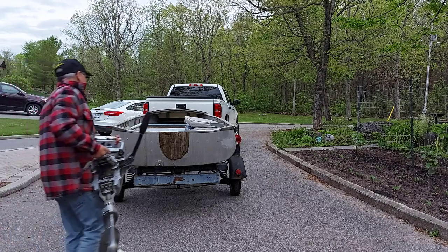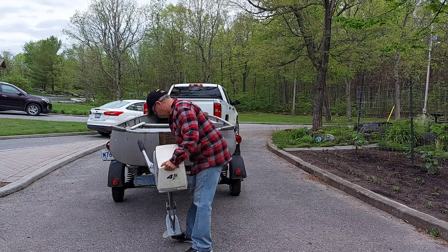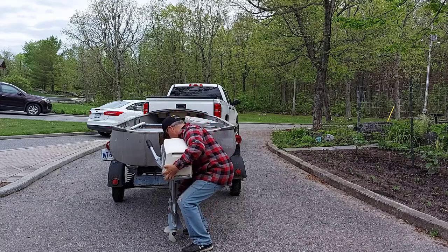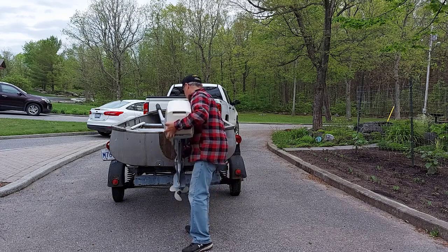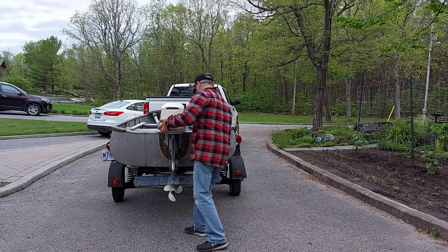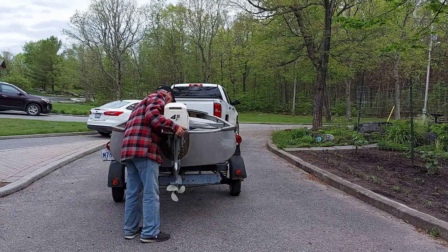What I didn't show you first was that when we tried to start the motor, the check valve inside the primer ball was rusted up and stuck in there, so we couldn't get any fuel up to the engine. I ran out to a couple of places to get a bulb but all the stores were closing or closed. There was only one place open and it was the wrong size. By the time I got home, dad had that check valve freed up and the primer bulb worked.